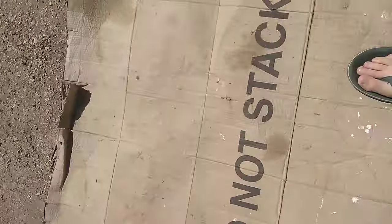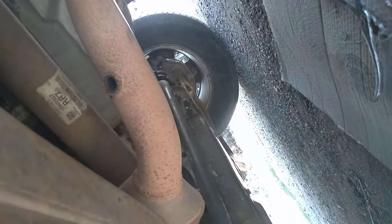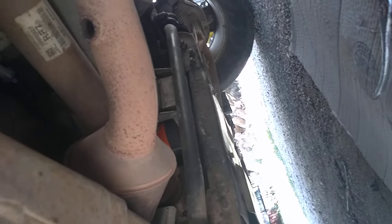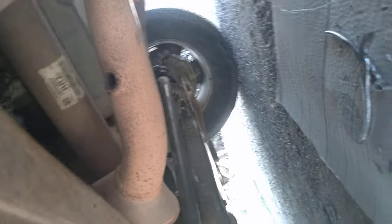Here's a quick video on how to bypass a catalytic converter on a GM. The O2 sensor that causes that code is underneath the vehicle, right behind the cat. There's the port where this sensor plugs in — that's what causes your cat codes and check engine lights. I already beat the guts out of this cat, bypassed everything that's in there, welded it all back up, but now I'm getting a check engine light.